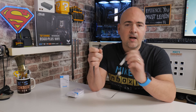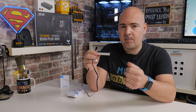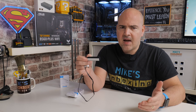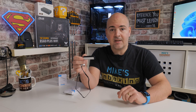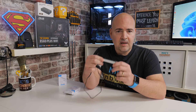For me particularly, I'm going to be using this with my Neutron Labs case, which comes with a fan controller, but it's one of those static fan controllers, so the fans always spin at a constant RPM, which can be a little bit annoying. I have, at the moment, wired all the fans individually to different fan headers across the motherboard using some splitters, which is okay but a little bit of a pain. I also have to make sure all the fans are individually controlled in the MSI sensor. Some of the fans are spinning just slightly faster than others, so it's not ideal — I want all the fans to be the same speed.